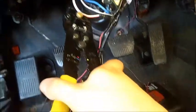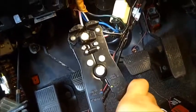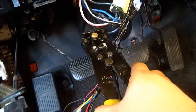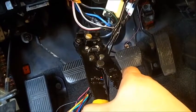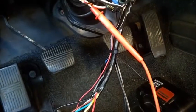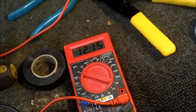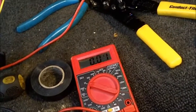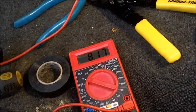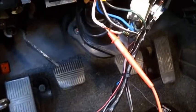The first thing I'm going to do is test this white-red wire. According to our tech sheet it's our 12 volts constant, but we're going to strip it and test it. I'm using auto strippers to strip the wire. I've got it poked in there, using our ground over here as a reference on my multimeter — red lead to the wire. And there you go, there's 12 volts. Took it off the ground, now it's nothing. So that wire is your 12 volts constant — that is what you're going to be hooking our red constant wire to. We're going to be soldering that as well.